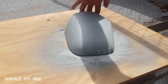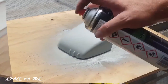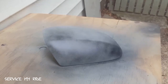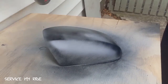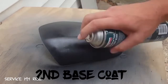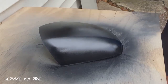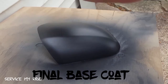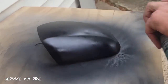Make sure it's fully touch dry before starting the other paint. Then we can start with our base coat — today we're going matte black to match the rest of the car. Apply your first coat as a nice light coat; you don't want to do a thick coat first. Do a couple of layers of light coats, waiting about five to ten minutes between coats — always check the back of the can to see how long to wait. I've put on three coats of black as well, so three coats of undercoat and three coats of black. I didn't do any sanding between the undercoats — it was all pretty good and didn't need it.